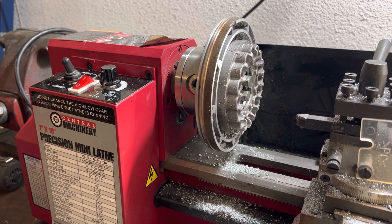In my particular application I am putting six clutches in my forward drum and running six 80-thousandths clutch discs and six 78-thousandths steels. To make that fit and still get my 60-thousandths clearance, my apply piston needs to be 600 thousandths thick. So with a 1970 forward drum I'm taking the factory piston and cutting it from 750 thousandths down to 600 thousandths in order to fit that six clutch stack. Let me show you what I do.